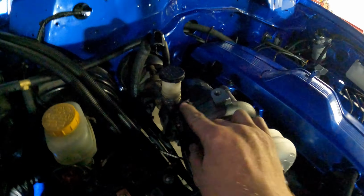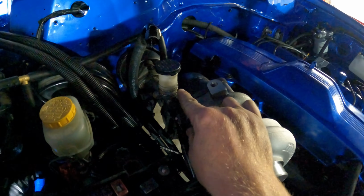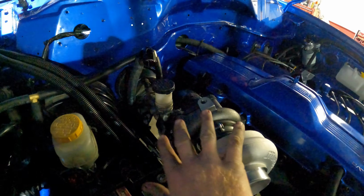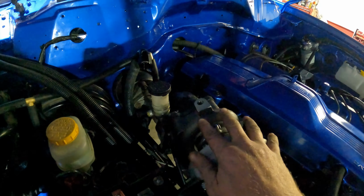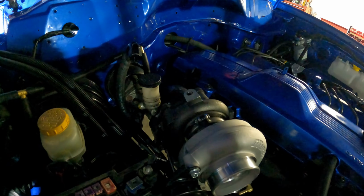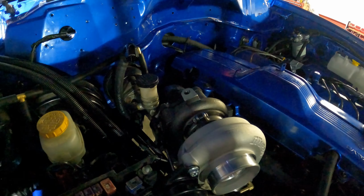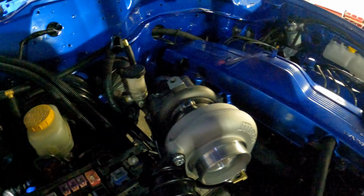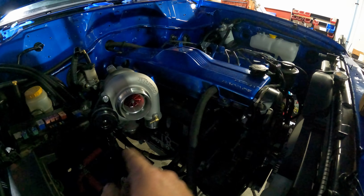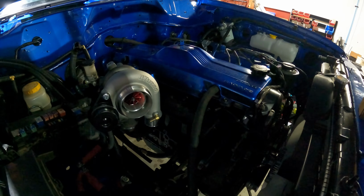The plan is, we're gonna make a heat shield for the clutch, so I won't lose pedal feeling when that starts heating up, because obviously it's going to get pretty hot behind there. So we're going to make a shield, hopefully that fixes the issue, but see how we go on the first drive, take it through a few heat cycles. Other than that, it's getting pretty close. Engine bay wise, it only needs cooler piping and exhaust and a thousand other things.